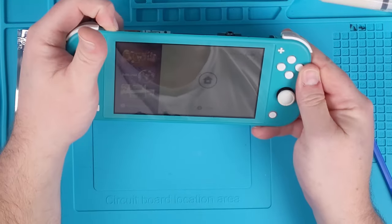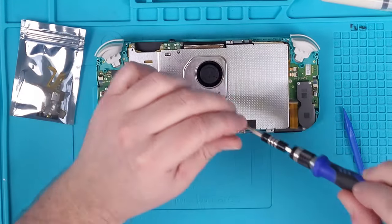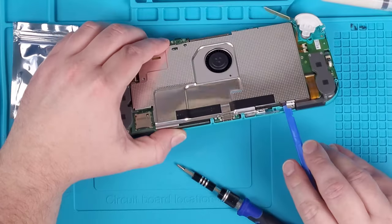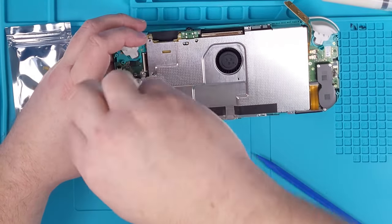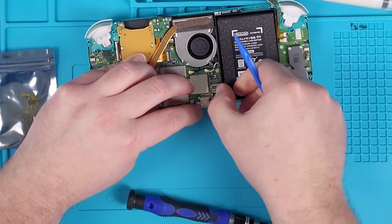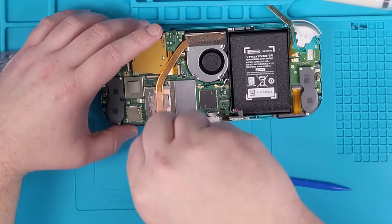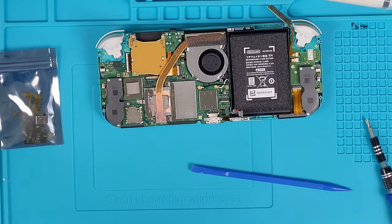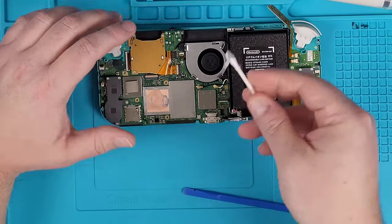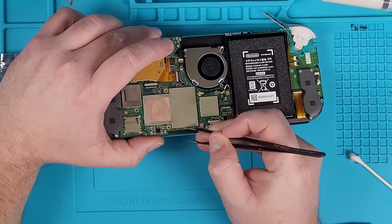Next, I checked to make sure it turned on — I was just paranoid. Now there's a back plate on the back that you have to lift off. Make sure you take out all the screws, or mess around with it for 20 minutes like I did to figure out there's another screw, and then it'll peel right off. Make sure the battery comes out because you do not want to short anything. The heat pipe was the funnest part because I didn't realize it was kind of taped down, and it also has some thermal paste that was gluing it down.